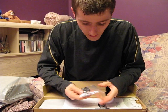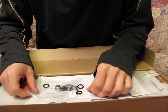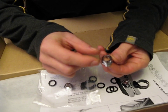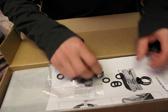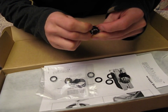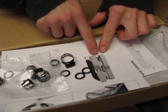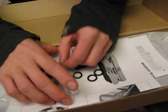Let's get into what comes in the accessory package. First of all, we have a wide variety of rubber o-rings — looks like it comes with six. We also have four little tiny stubby fittings; they are all half-inch fittings. So how this is designed to work is if you have two of these stack radiators, or a stack and a non-stack, these o-rings are for all the fittings needed to stack two radiators together with two fans sandwiched in between. You use the little stubby fittings and the water actually flows in parallel between the two rads.